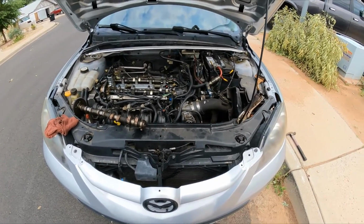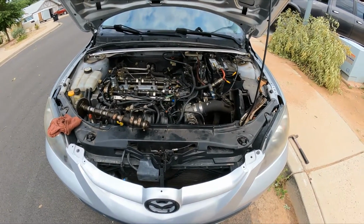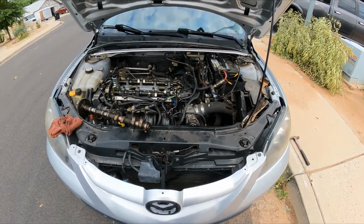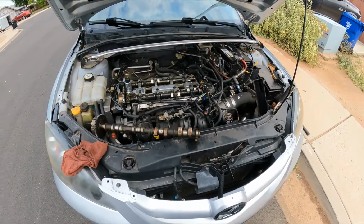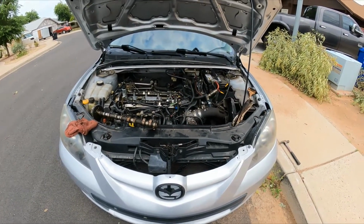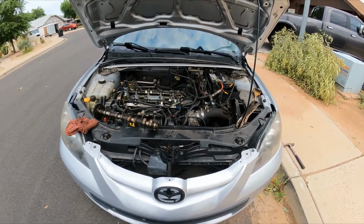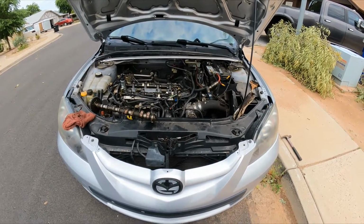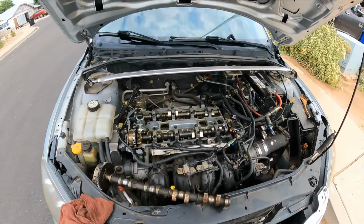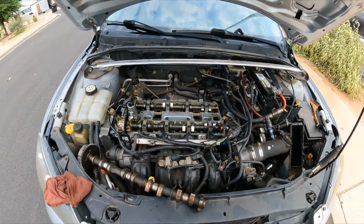Anyhow, this is a 2005 Mazda 2.3, stick shift, manual transmission, 4-cylinder obviously. The problem with this vehicle is that it doesn't start. It starts for a second or two and boom, dies. This vehicle triggers a code P0340. What it says: camshaft position sensor.